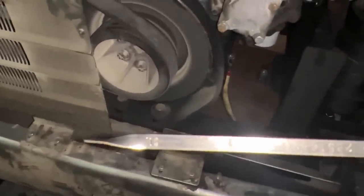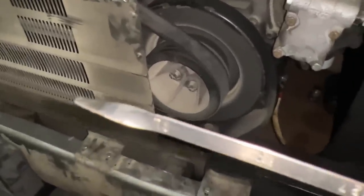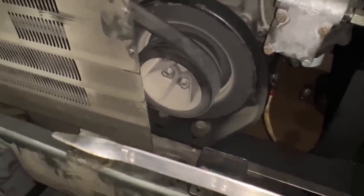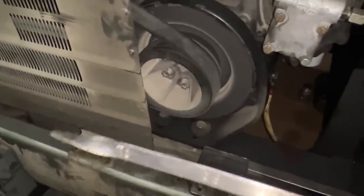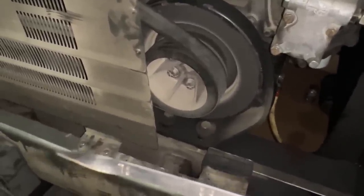for this vehicle. So we can make an adjustment on that. We'll see if we can modify that tube over there so the dipstick will go down in there a little further. But we know we have 11 gallons of oil in it right now. We know that it's the wrong oil pan. Part of the concern, though, is the oil pan is extra deep, so the sump is high up on the oil pan, so you're never going to get all the way down to the bottom on it. So we're slightly concerned about that too, but we definitely don't want to run it.